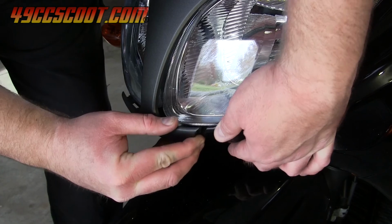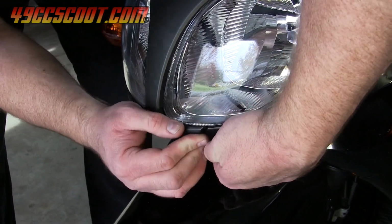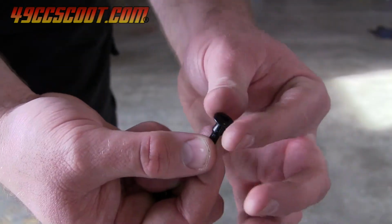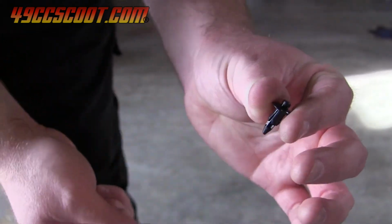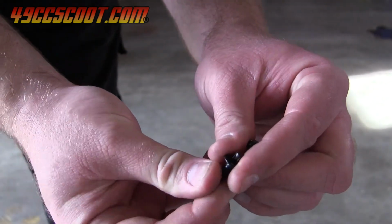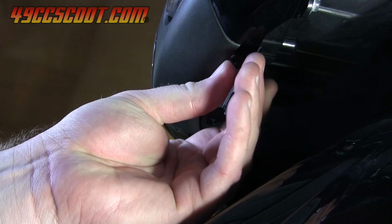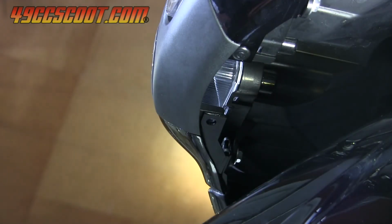Then the bottom section was pushed in on each side, and all that was left was to install the push rivets in the very bottom of the panel. Before installing them, I pushed from the bottom of the rivet to make the pin protrude above the top as shown to make them easy to install. Then the rivets were inserted into the holes, and pressing the center pins down so they were flush locked the rivets in place.